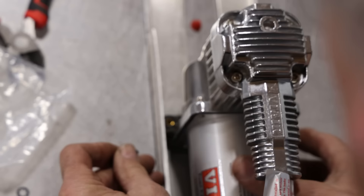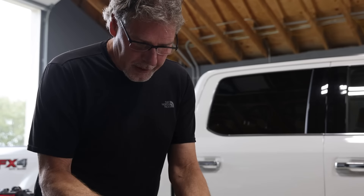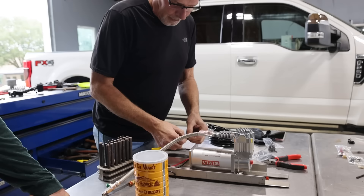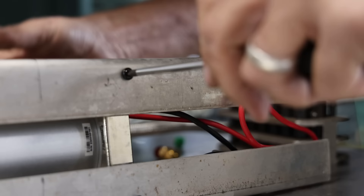Someone will probably comment saying 'why didn't you do it this way?' — because I didn't know how. The washers that came with the kit are the same size as the hole, and what keeps them from going through is just a rubber grommet. If you tighten it too much it goes right through the grommet and the hole. You need bigger washers to sandwich the metal so it doesn't fall out. It took three hours the first time.